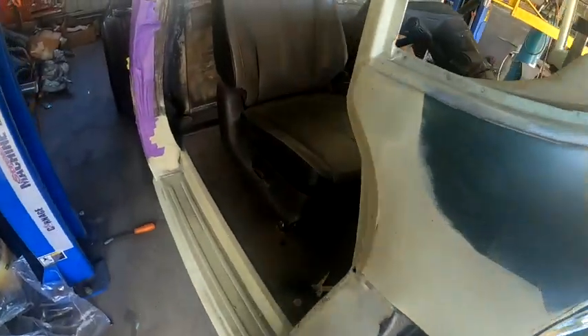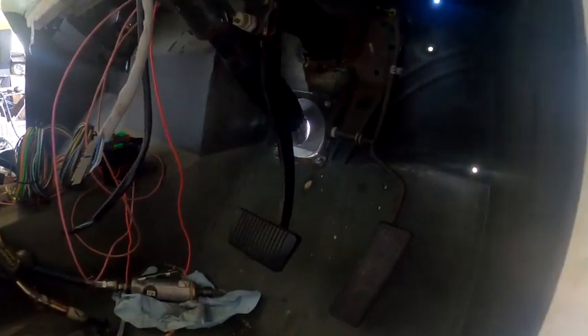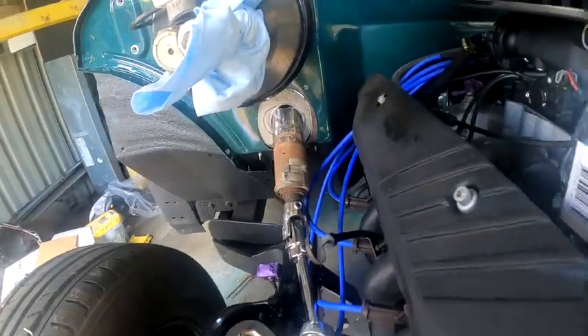I've got that plate drilled out and mounted to the firewall with tech screws for now. Then I went ahead and cut out some cardboard, made a little template, split it in half to make a plate to mount the steering column and seal it off on the firewall. Going to rip this out, make that plate, and bolt the column back in. Got that plate made up and the steering column back in — pretty happy with it. Going to tack weld it in, then pull the column back out to finish weld it.